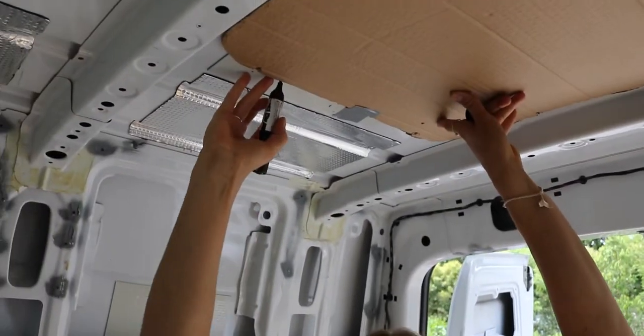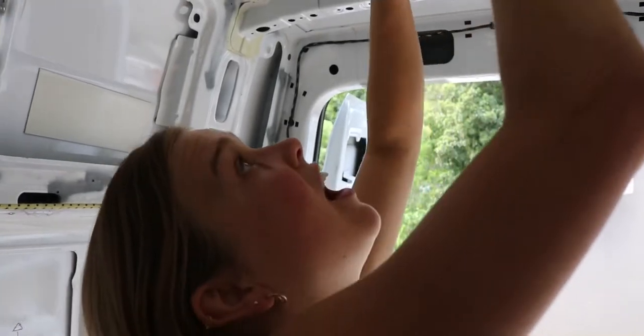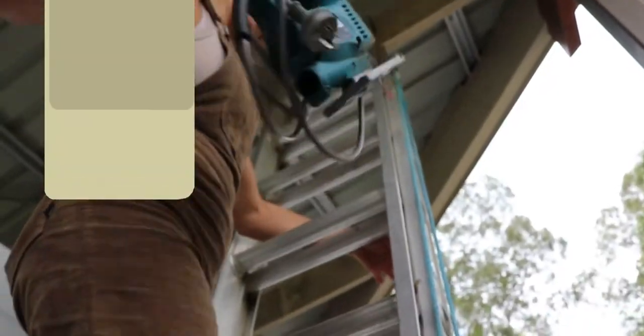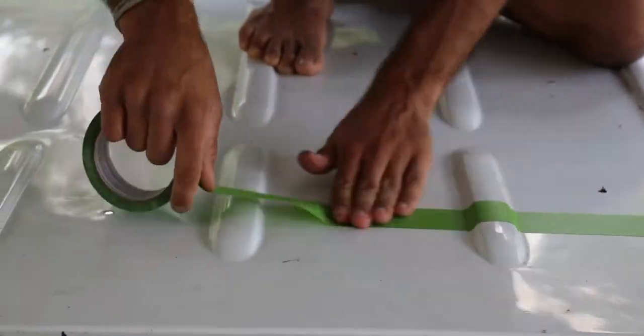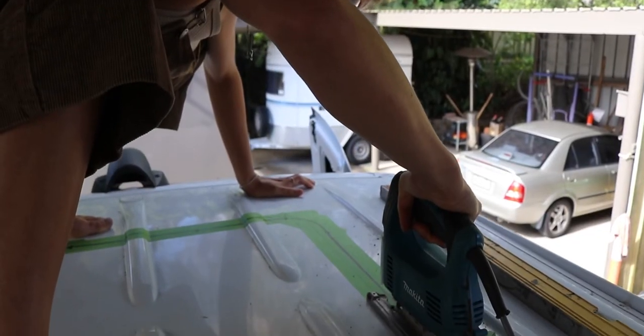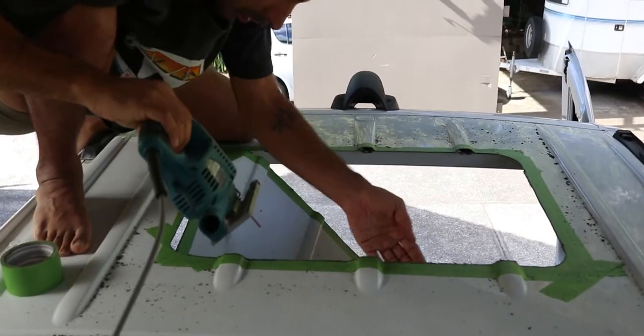So you can go straight to creating a cardboard template of the skylight. We've taped our template to the roof and now I'm just drawing a trace around it. Then we're going to drill pilot holes on the inside of the line and then cut it out. I feel like I'm eating metal. So once you've drilled your holes, all you've got to do is have a good clearance above the roof of your van and jump through it. I taped and traced over the pilot holes, then did some measurements to make sure it was all dandy. Then we cut out the hole with the jigsaw. After we cut out the hole, we filed down the edges just to make sure it was all smooth.